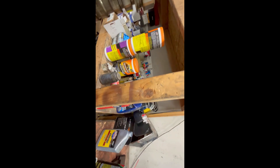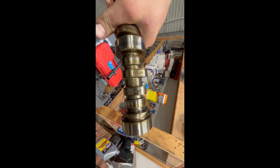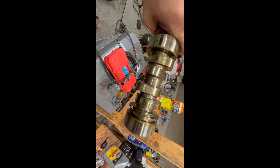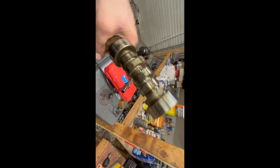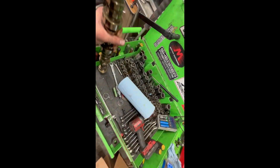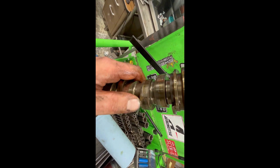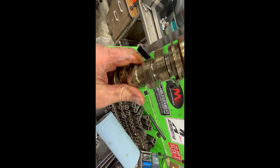Working it out on the third one, and it's not going to be until this last journal that we see damage. There it is - the cam is out. You can see right there - that lobe is trashed. From what I understand, it's the lifter that fails first. The lifter spalls and loses its outer hardness, it peels away that metal, and then starts digging into the cam.